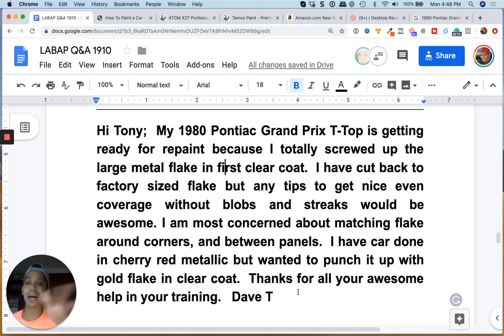Then I would lay that on top till you get your desired coverage on one coat. You can keep passing it, crisscross it, get it the way you want. If you feel like you need more, then let it flash, then give it more. That's going to give you a clear coat cushion, so when you put your flake on top, the pointy edges actually get buried into it.